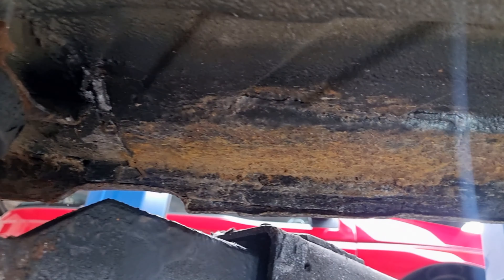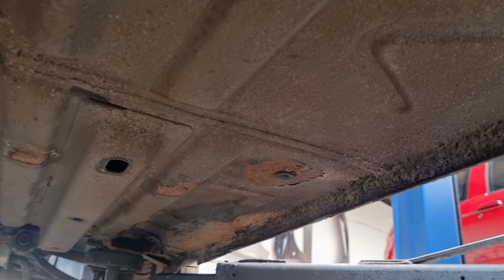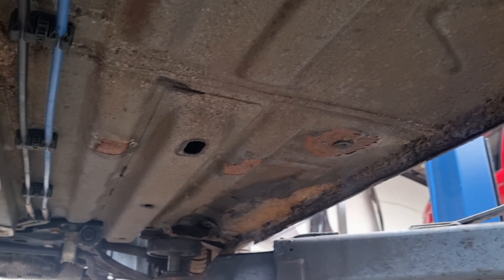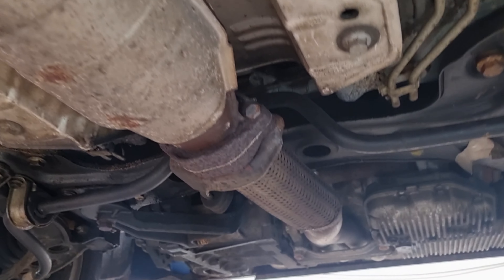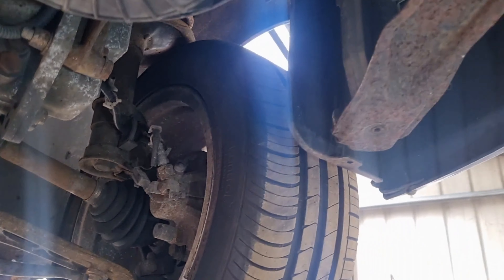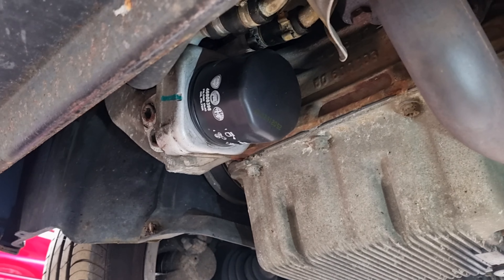The same on this side — a little bit of rust coming through there. But the back of the chassis is in really good health. Looking at all the nooks and crannies, because these chassis are very similar to the Mk1 Punto's — they're almost a Mk1 Punto — and all behind here is all good. The exhaust isn't leaking. There are no signs of massive engine oil leaks. The front support bar is rusty, but I think I've got another one to put on anyway. A genuine oil filter is fitted with nothing leaking around it.